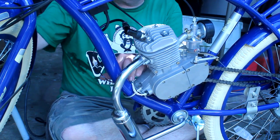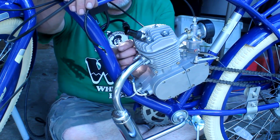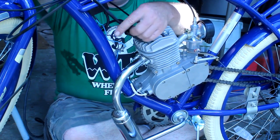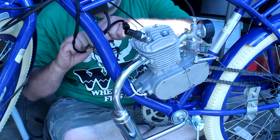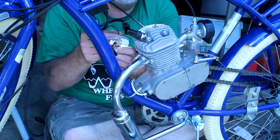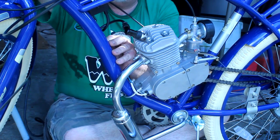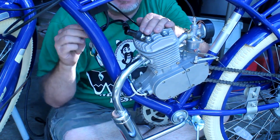I'm going to tie-wrap my wires. I've got the control wire from the throttle grip — that's the kill switch — and it's going to connect to the two wires here. It doesn't matter which wire it goes to. If your wires aren't long enough, cut them, get additional wire, and extend them. Make sure your insulators are over your wires and that bare wires are not touching or rubbing against the frame. You can add electrical tape or use shrink tubing with a heat gun. Tie-wrap everything to the handlebar, making sure you have a full range of handlebar motion without putting stress on the wires.